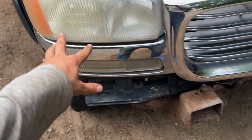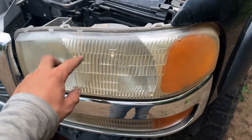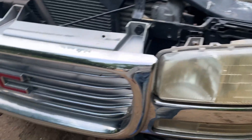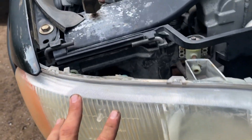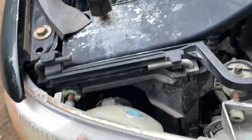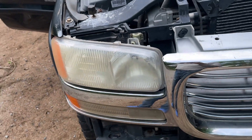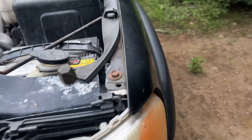However, both lights are out, which makes me think it's probably a fuse. I'm going to check with the voltmeter after checking the fuse box — see if it's just a blown headlight fuse. Either way I've got parts trucks all over here I can take parts from, so that's good.